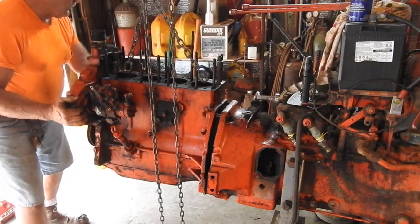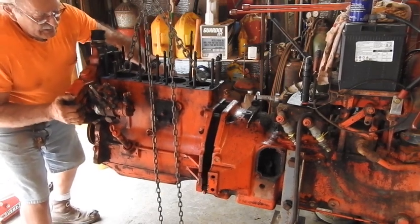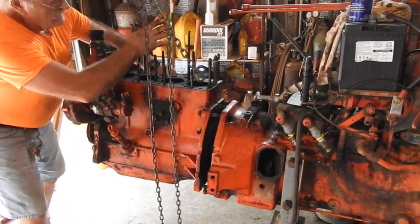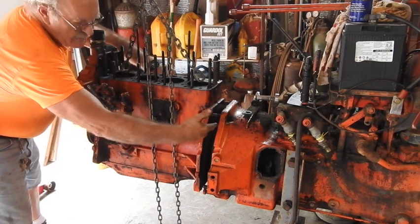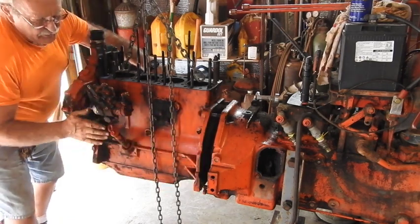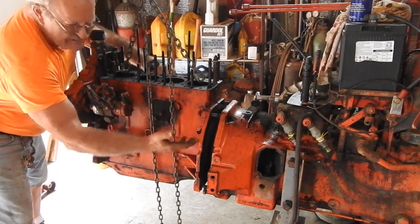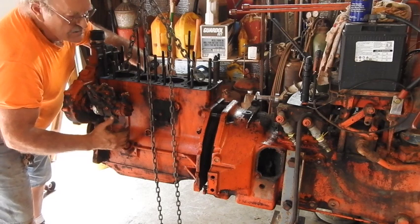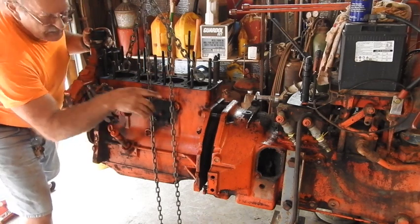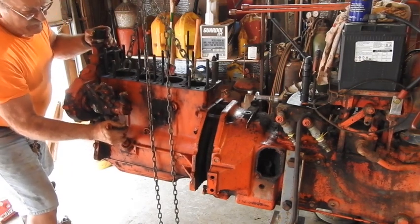Once you get the nuts or four bolts loose and removed, you've got to be gentle but you've got to get a little rough with it at the same time, because those things sometimes are sucked in there really pretty good. Once you get it to that point, you should be able to very gently walk it out. When you've got this leveling chain, keep an eye on the gap here and here because you want to remove that perfectly straight. You don't want to remove it at an angle downward because you can bend your mounting bolts. The flywheel and the spline should slip right off of the spline from the input shaft.